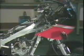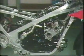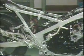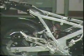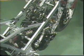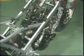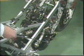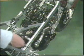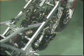Incidentally, some service jobs can be performed without removing the engine. For example, servicing of the top ends overhaul, the pistons and cylinders, and some clutch parts. Now back to engine removal.